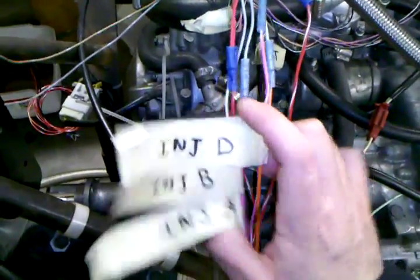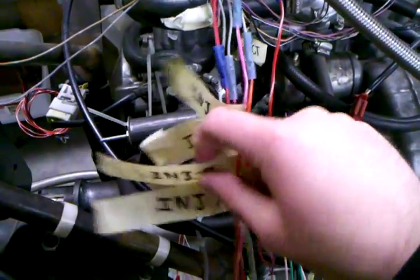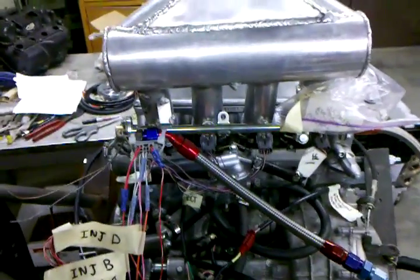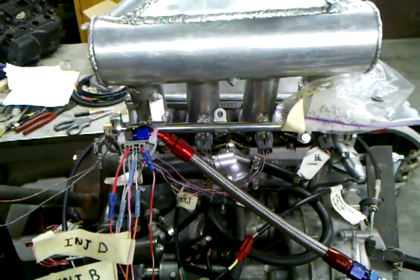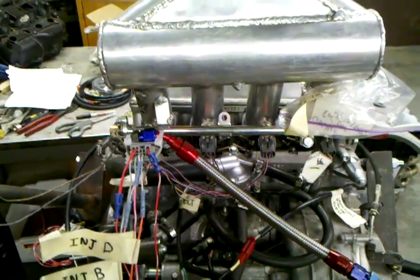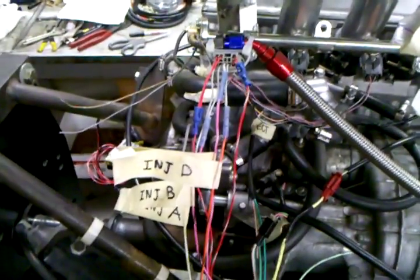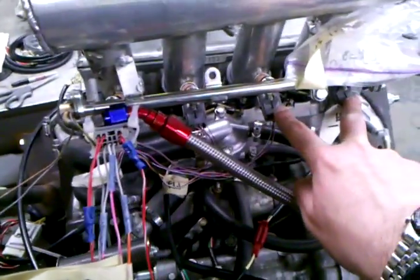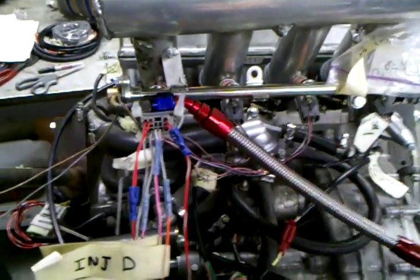It's important to note that cylinder number 1 corresponds to Injector A, cylinder number 2 corresponds to Injector B, and so on and so forth. This concludes how to wire the fuel injectors for a 2006 Honda CBR600RR if you plan on using a Megasquirt version 3 with a Megasquirt 3 expander card. None of these injectors are wired to the main board itself, but instead to the expander card, and the 12 volts provided to each injector is supplied when the ignition turns on.